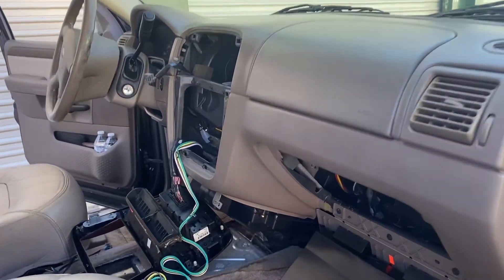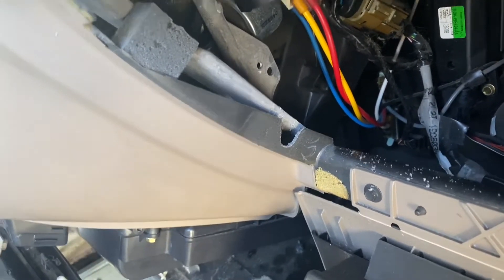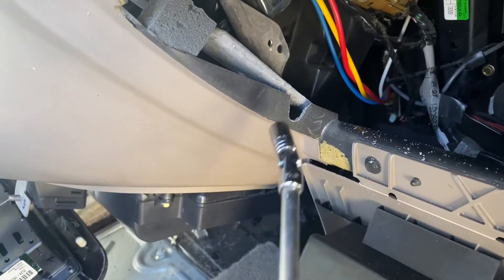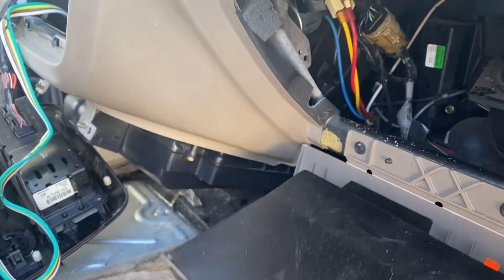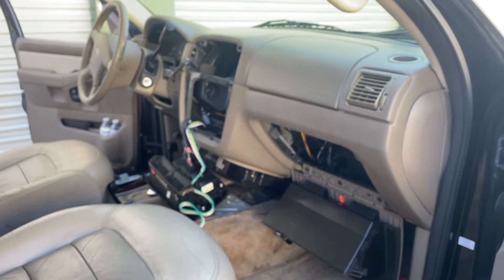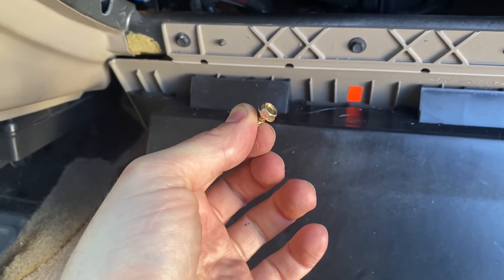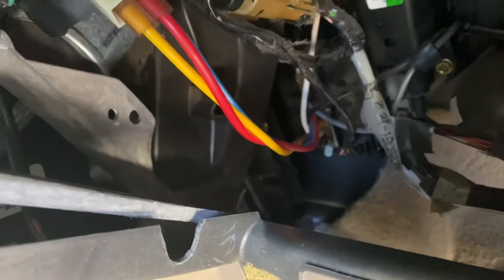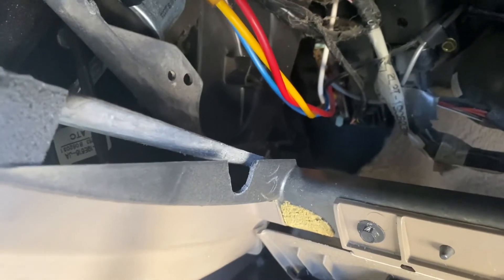You saw how I removed the other two bolts. The final bolt is right back here - you can barely see it. But you can see that I cut out this section right here. I drilled a hole and then used my hacksaw to finish off the cut. That allows me access with this swivel socket to just sneak back in here and remove that bolt. It's pretty inconsequential because once you've got this glove box up, you won't see it, and it makes this a lot more serviceable. You definitely need the swivel to take out the bottom right and the top right bolts.